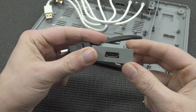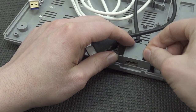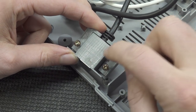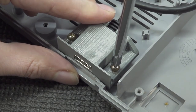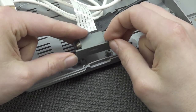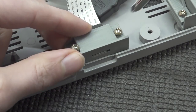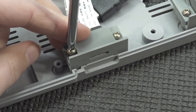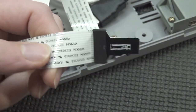Let's take a close look at the back. The first thing I'm going to assemble is the HDMI. I think I'm going to need a converter if I want to use a Raspberry Pi 4 in this, because if you want to make this thing an ultimate crazy PlayStation 1 emulation beast, we need to have at least a Raspberry Pi 4. There are two parts here that overlap, so let's assemble this, get it in place, and tighten up the screws. The next bracket is for the SD card — very convenient so you don't need to open up the casing every single time. We'll also get the ribbon cable that you plug into your Raspberry Pi unit.